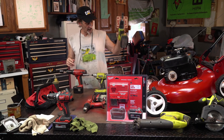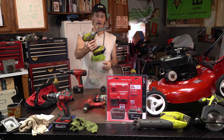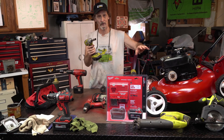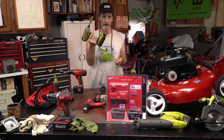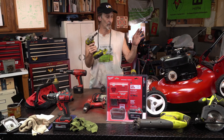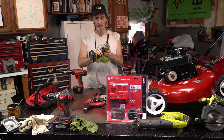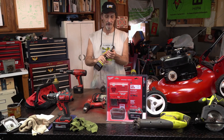This came with the kit and it's very inexpensive. This is the impact, which will not take off everything — like a lot of times the wheels on these lawnmowers, the bolts will get stuck, the nuts will get stuck. And I use an impact a lot on these lawnmowers, because you should not be putting a lot of force on most of the bolts. I see a lot of guys screw up and ruin stuff because they're using these banger tools. This one's a little underpowered.